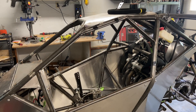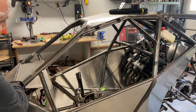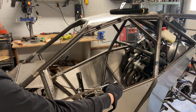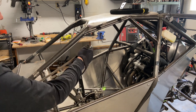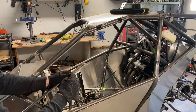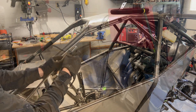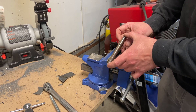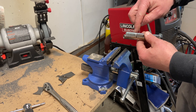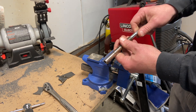The frame is taped in place and now it's time to add the hinge. I have larger diameter tubing that I'm going to align with that, and I got some bolts that will fit tightly into this. I'll even thread it so maybe we won't need a nut. I'm going to cut this into three or four equal parts. The bottom part I'm going to tap for the thread size so that we can just screw it in. The door gets the outside sections and the chassis gets the inside section. I'm using 3/8-16 thread.